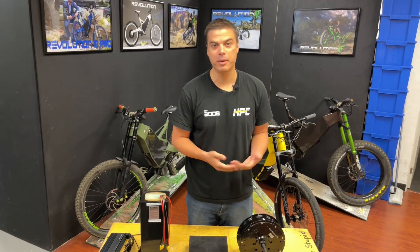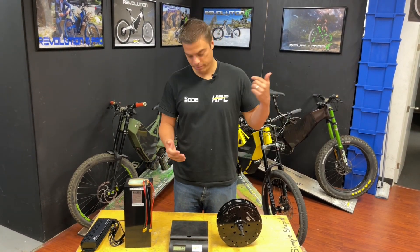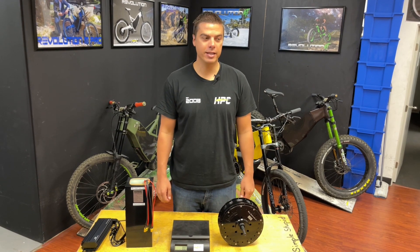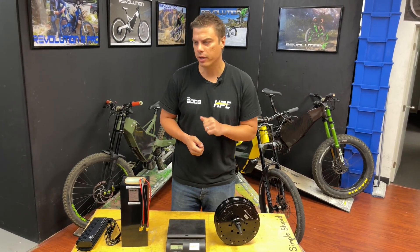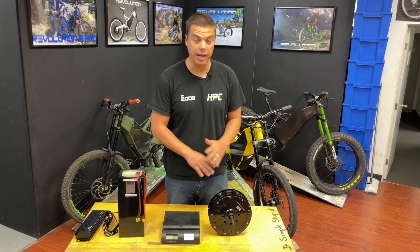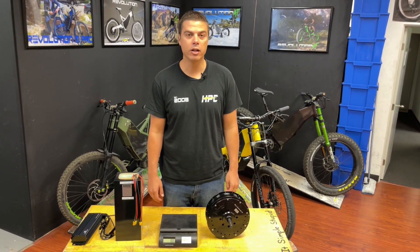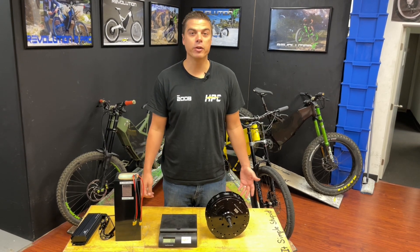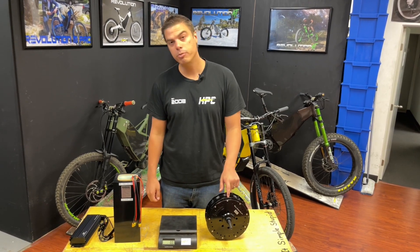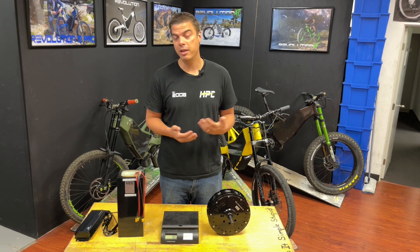You're going to allow the kinematics of the suspension to work a lot better. Unsprung weight is substantially less now — over a pound of savings. So a 19 pound motor with over 8,000 watt capability, and this thing just screams. We get a lot of calls like, 'Hey I have this bike, it's 14,000 watts — why is yours only 8,000 watts?' We have a self-imposed weight limit of 20 pounds. We're not going to put over a 20 pound motor on any of our off-road bikes — it goes against our ethos and you're just fighting that unsprung weight. We had a customer come in with a 14,000 watt bike, strapped it to our dyno, and it actually made less power to the ground than the new 8,000 watt motor on the Revolutions. So a lot of times you'll hear numbers, but in actuality that's not what you're actually getting.